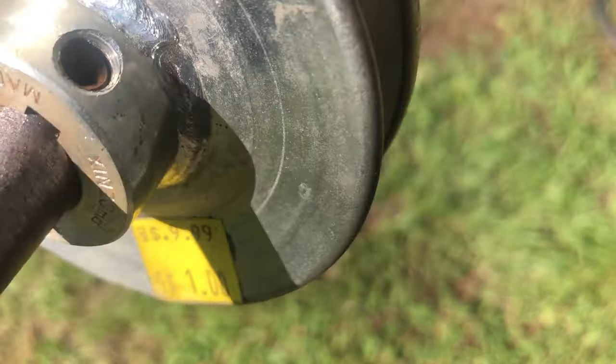And on the other side, there is a brake pedal. If we do the same 14 inches, mount it the same way, make it match, the brake pedal can go down past the running board, will stop right about here. Use that hole just like on the other side, get rid of this junk, and it will not interfere with the brakes back there. Let's go for it.